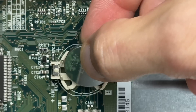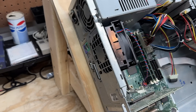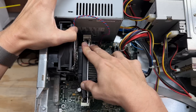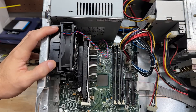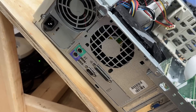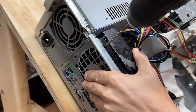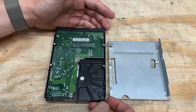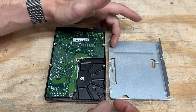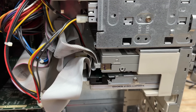Let's get this thing put back together with a fresh battery. The world's most brittle fan — close enough. The CPU bracket worked. And the only clip I didn't reinforce did not make it, so the only solution right now is a zip tie. Now it's time to choose a hard drive — I believe this originally came with a 12-gigabyte drive, so this 13-gig Western Digital is close enough. This thing has a very odd hard drive bracket that just hooks onto the drive through two screw holes and mounts upside down in the case, which makes for an interesting IDE cable arrangement.